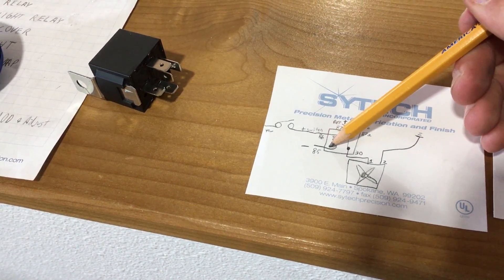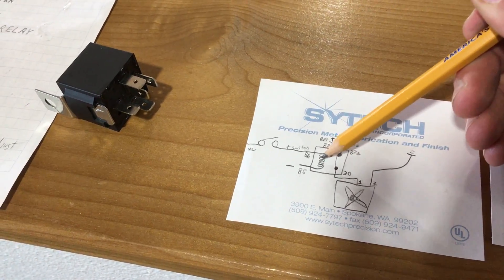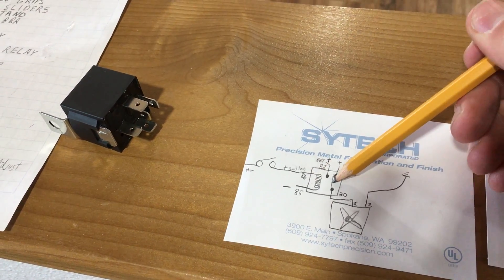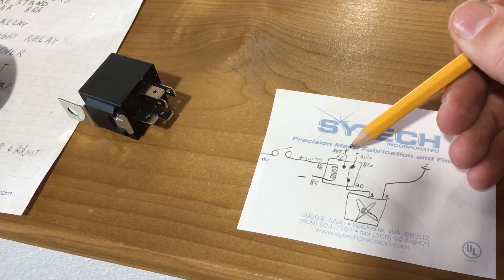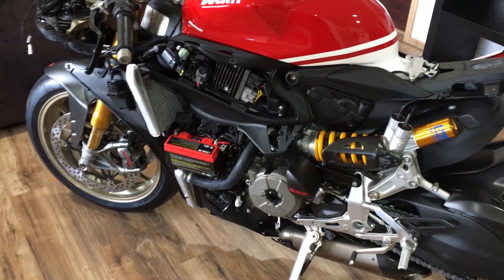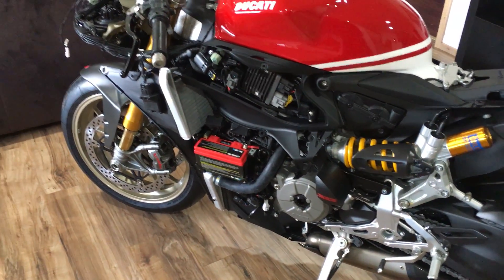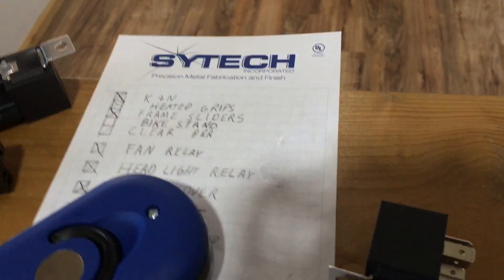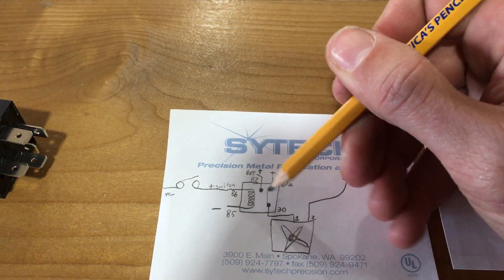How this works is 85 and 86 on the relay — when you put a negative and a positive to that, it charges this electromagnetic coil and it pulls this bar over, so it acts like a switch. That's why they call it a relay — this switch is turning on this switch. The reason you want to do that is because you want to pull directly from your battery. You don't want to pull off the ignition of the bike. The wires in this bike are specifically small gauge — they do that just to shave weight, so you really can't add any more current draw on any of the existing wires. So connect 87 directly to the battery and 87A to the wire that was already going to the fan. This way you can kick it on manually or it'll just run on auto.